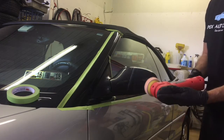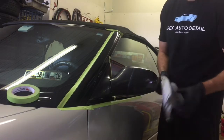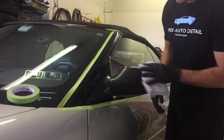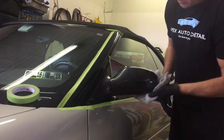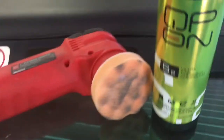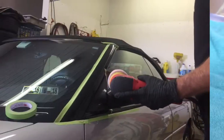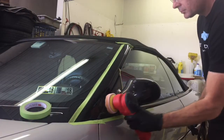We're going to do a little section here, do some testing and see what chemicals work. I'm going to start with the firm pad, which I always use, and we're going to use the QPon 6.2 Ultra Fine Cutting Cream. Let's come in close and get a look. That works great, so we're going to use that to polish the plastic trim all the way around. We're going to stick with the QPon 6.2 Ultra Fine Cutting Cream and the Griots Garage three-inch with a firm pad.